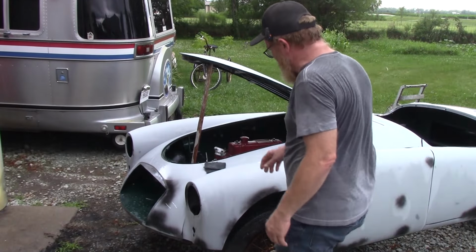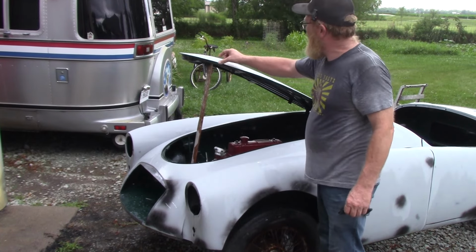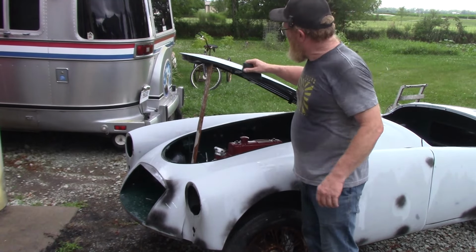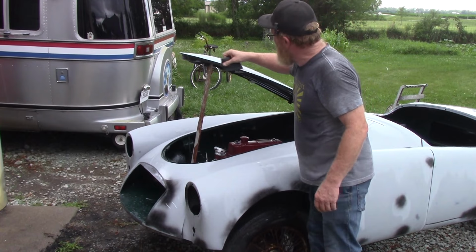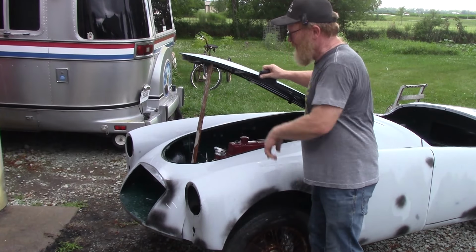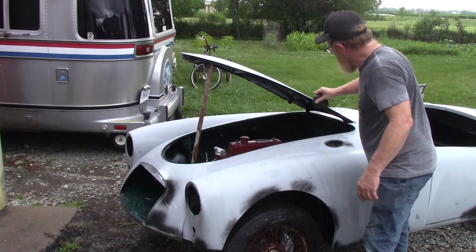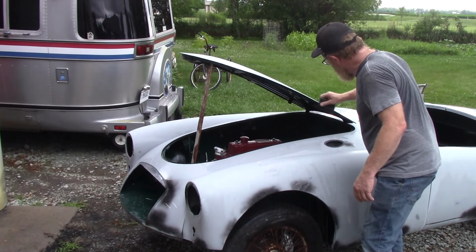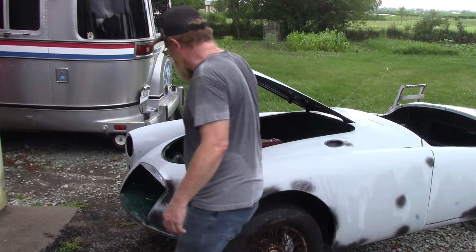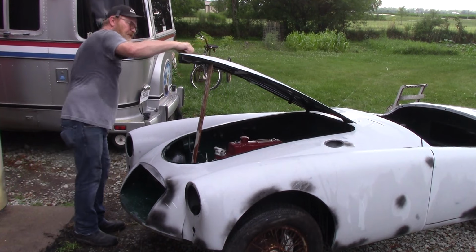All right, so I got my Scotch-Brite. All the edges. You remember me? If you've watched the other episodes, I painted all the way to the edge of all the panels. Now I want to make sure that that's prepped nice. And then plus we've got some guide coat in there we want to clean off. Everywhere is going to, except paint, you got to have something going on to make it stick. So it has to be clean and give us a good mechanical adhesion.